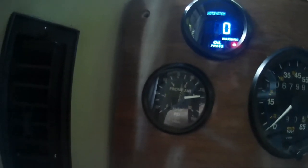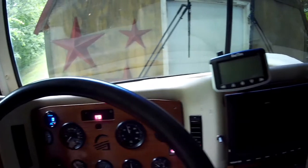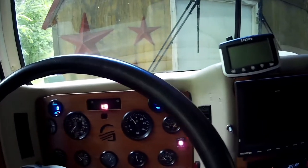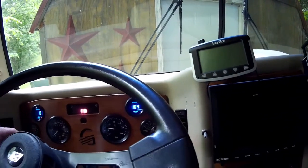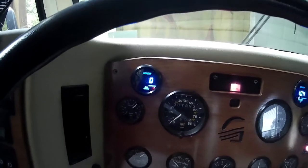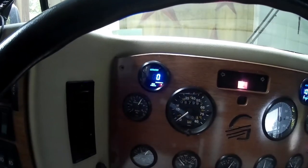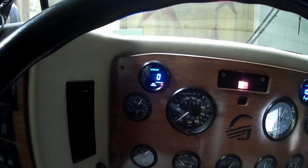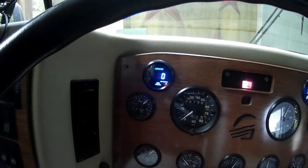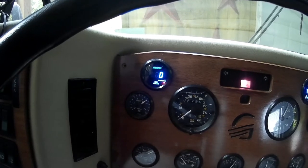About 120 pounds now, and there went the purge — super duper! That's what I needed to know right there. So at exactly 120 pounds, it purged. That's awesome. Let me pump the brakes a few times to get the air down and get the compressor to start back up, and we'll build again. There it goes, coming on back up. Hopefully when we get to about 120 again, this thing will go ahead and purge — and what do you know, it purged.